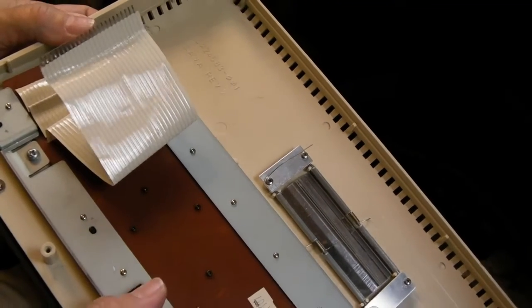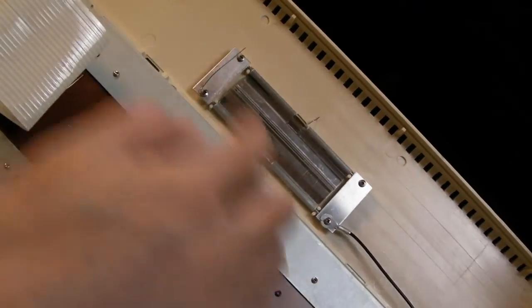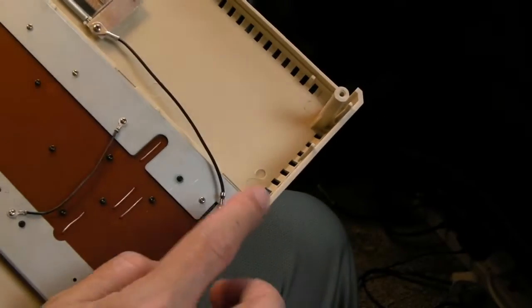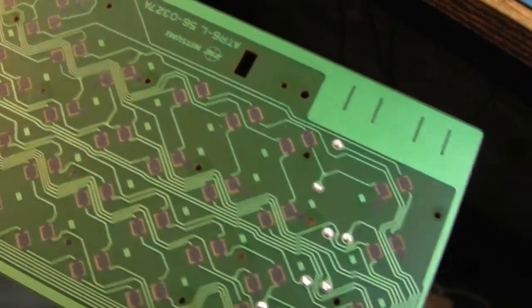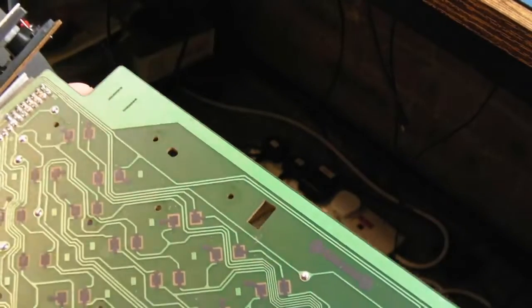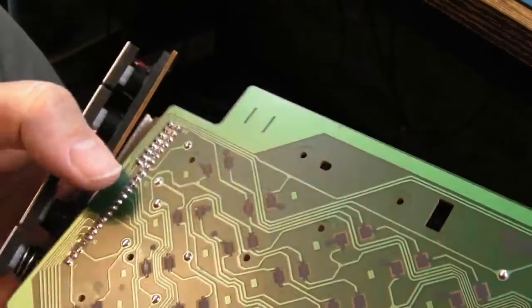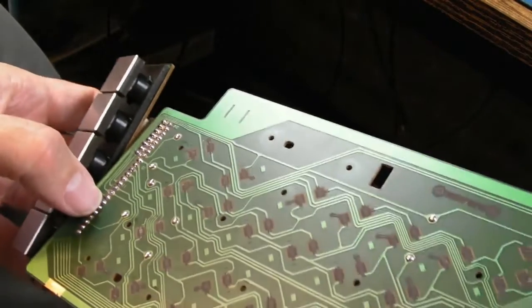Anyway, let's get all the screws out of this. There's millions of them. Let's remove the ones from the chassis first, all these ones. It's like four screws around the edges of it, holding it together. Get those out, and then we'll get these millions of screws out of here. Yeah, as I suspected, it's a PCB here, so we can just gently clean these contacts, but bear in mind these work. There's a bit of wear here, look, there's a bit of wear here. I'm guessing the function key thing, and this is the bit that's not working, actually, so I should have took this bit off.